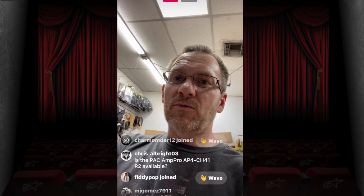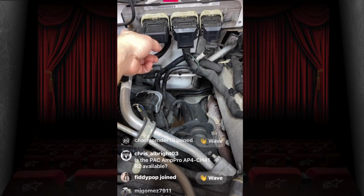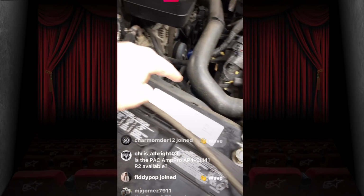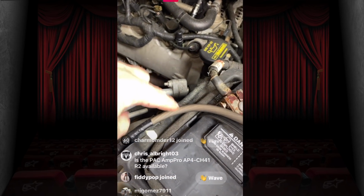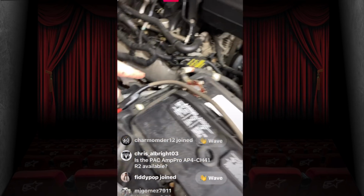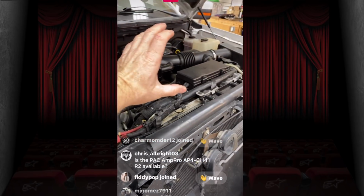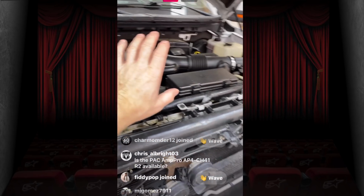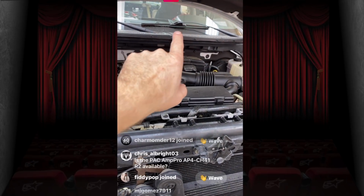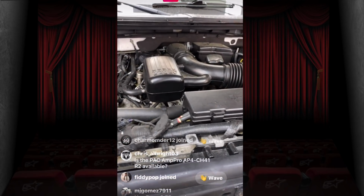One of the problems we were having was, in this particular car, the power wire was only coming out of the firewall there, and his fuse holder was mounted to this bolt, which meant he was way far away from the positive post, which is over here. We needed our fuse holder to be somewhere in this area, so we got it just long enough to go right here, and that'll keep us within a safe length for this installation. To do that, we moved the amp over 12 inches into the center of the vehicle, and that meant we had to move the power window motor over 4 inches. We unscrewed it and put the screw that was on the left into the right hole, and then made 2 new screw holes using rivets, put it all into place, and that gave us the room we needed.